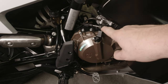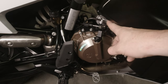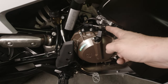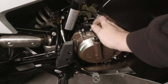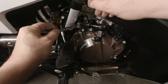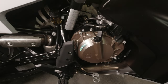The super gross adjustment is done with the position of the arm. This is the same kit that fits on the 790 and 890 — the tank comes down quite a bit further on those, so we have to worry about tank clearance with this arm, but on the 901 it's not nearly the same issue. Where we've got this right now, we can tighten up the jam nuts — hold the front jam nut and tighten the rear one.